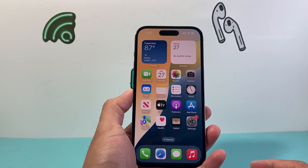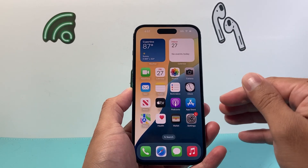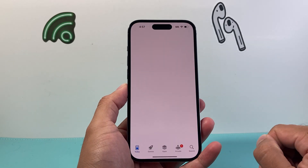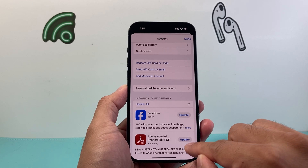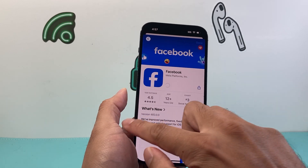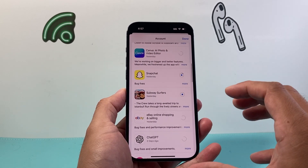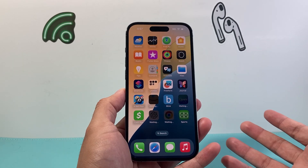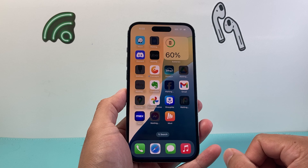Now after you've done that, the next thing you want to do is ensure that the apps are up to date, because when you update iOS, the software of the phone, they'll also update all the apps you have running. To find those updates, simply go to the App Store, click on your profile up at the top, and it's going to show you how many apps need to be updated. You can manually click on each one or simply click Update All and it will begin updating all of the apps. This takes a few minutes, and you should see them all downloading and installing the latest version to be compatible with iOS 18. If an app is running an older version, it's likely to have some issues which the new update will fix.